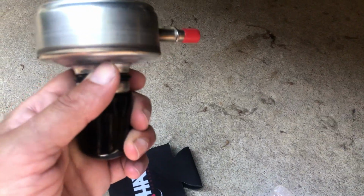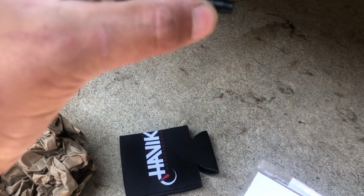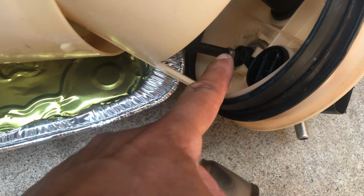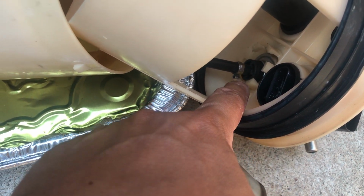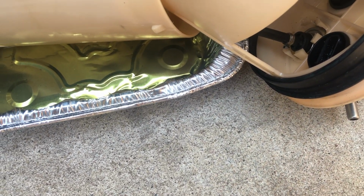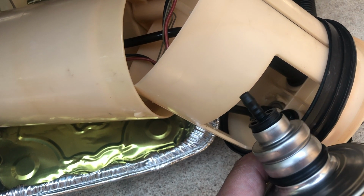So now that I know what I got here, take this protective part off. Okay, perfect. So this little nipple here is going to slide right into that black hose. So what I'm just going to do is cut this hose because I can't use this part that's already been clipped anyway. It's already been deformed, it's been on there forever, it's not going to be flexible. So I'm going to try to reuse this same hose and just clip it right there and then slip this in through the top, of course, and hopefully I can get the clamp on there and we'll just kind of go from there. So definitely need 2 hands again, so give me a few and I'll come back hopefully successful.